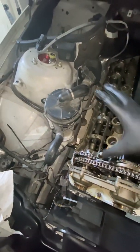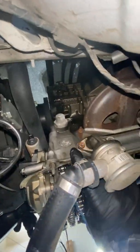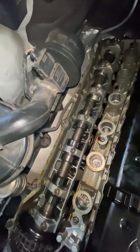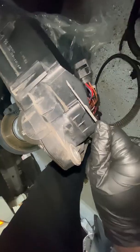I'm going to remove this — I believe this is a secondary air injection. I already bought the backing plate that attaches to that piece right there, so I'm just going to go ahead and remove this entire thing, and then it'll give me access to the oxygen sensors here and here. This was cut on the old cover, but I just lifted this flap here and it'll kind of slide between this little plate, so it won't be attached anymore.